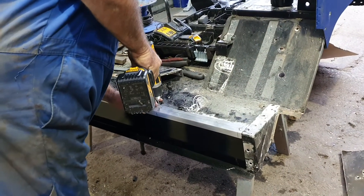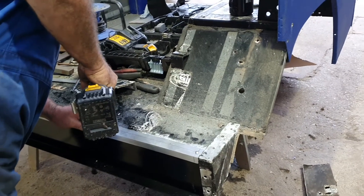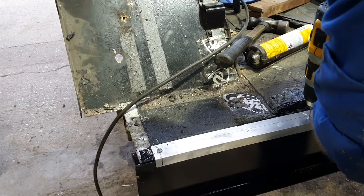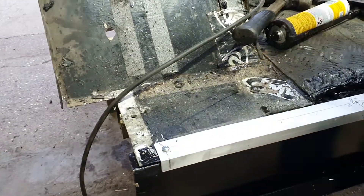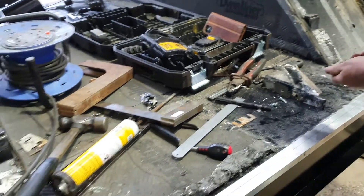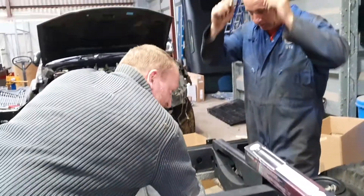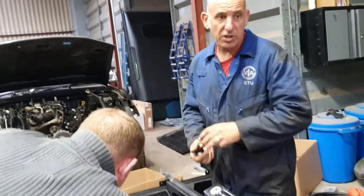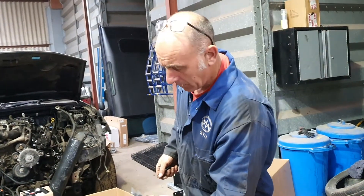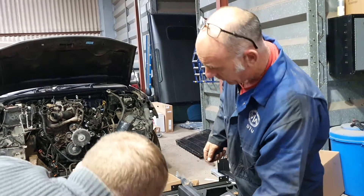Now, what Kev's up to — we mentioned earlier about the rotten front panel, which is at the front of where the seats bolt to. That was rotted out so we replaced it with a replacement panel. Then we found the top was pretty bad too, with holes rotted out. Kev's fabricated a new piece so we can put the holes where we want them and fit it all together. We're putting the tank guard on now, and then the tank will go in. The issue is the tank guard is a little bit longer than expected.